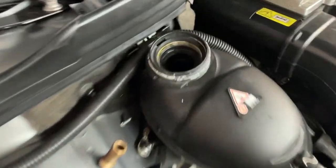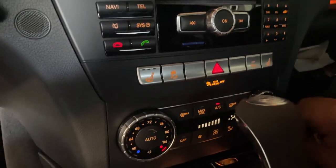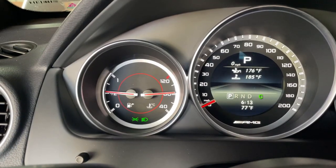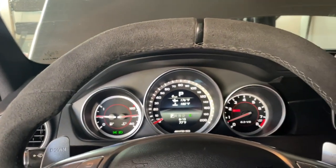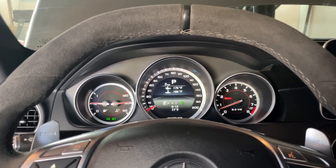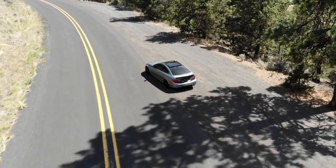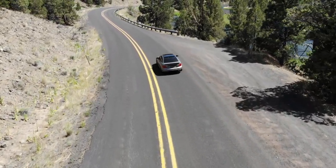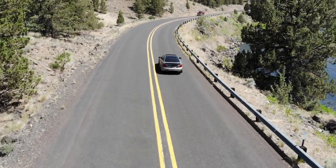The coolant is now nice and blue — clearly not red. Cap it off and start the car with max heat on front and rear. Make sure the temperature is above 80 degrees Celsius, which you can see it is. Wait just a few minutes and any air bubbles in the system should pop out. Then correct your coolant level and top it off if necessary. Even after topping it off once, I'd check it again after a nice long drive to make sure your level is still exactly where it should be. Hope this video helped you maintain your M156 and keep it in tip-top shape — if it did, please leave a like and think about subscribing.